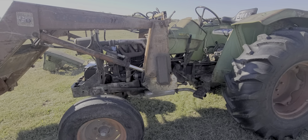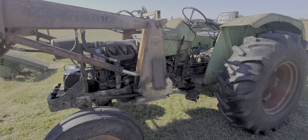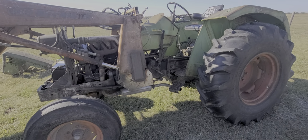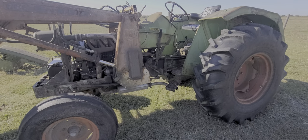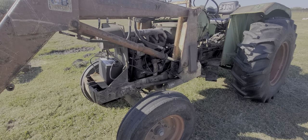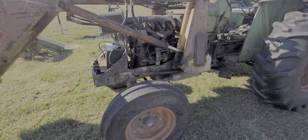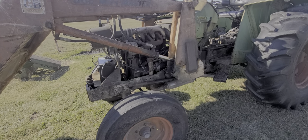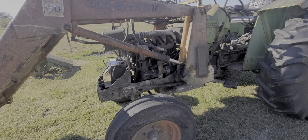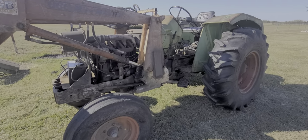Just shift carefully, and the way I shaped the gears, that's been ground in there, I shaped that up so that it's not as coarse. It's working very well now, surprisingly. The engine is surprisingly in good condition. I didn't expect that at all. I'm pretty surprised. I don't even have to undo the transmission to get everything out and do its guts. It's been possible to remedy it through the underneath, like I said.